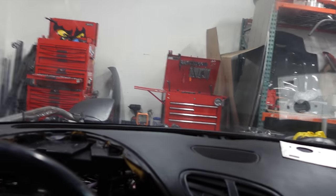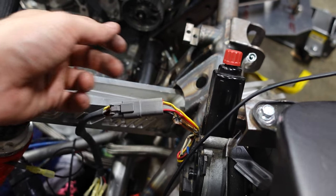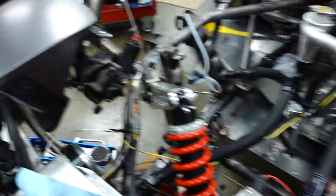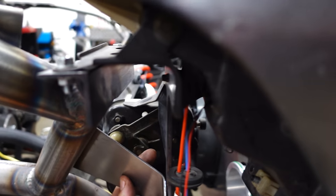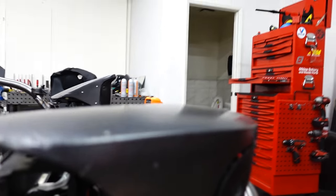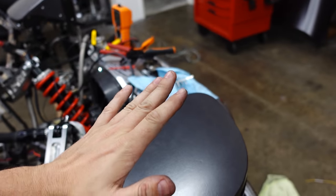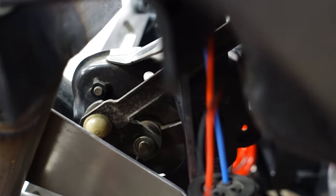I had the left headlight wired wrong — that was apparent — and it caused the right one to flip up and down. Let's see what happens now. I messed this one up; I have to pull the piece off and spin it. I had swapped it upside down — I was looking from the top and wired them in backwards. That's not a big deal though. I just need to take that little positioning motor — there's a little thing on the back side right here — take that nut off, it's got splines, pull it off, get it all the way up to where it's supposed to be, and then put it back on the splines and tighten it down.